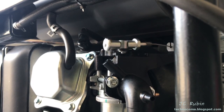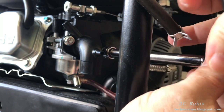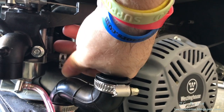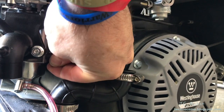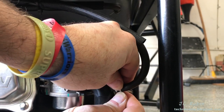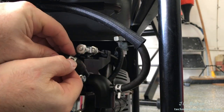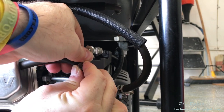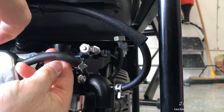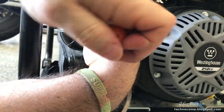Go up front to verify correct choke operation. With the choke good, snug both nuts down with a ratchet — remembering this is plastic, so only snug, not over-tightened. Now reconnect the fuel line to the carb, squeeze the clip, and reconnect it forward at the base. This is followed by the emissions tube reconnected to the manifold, and finally the crank ventilation hose. Push the hose down and clip it — if the clips are tough, flat nose pliers make it easy to open them. Move the air hose back into position on the manifold and snug down both hose clamps, completing the procedure.